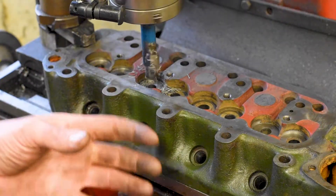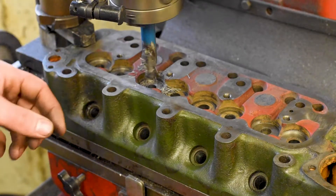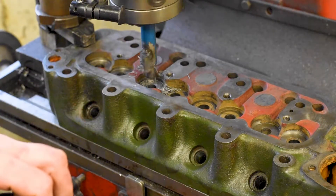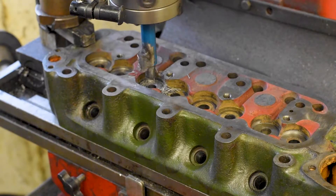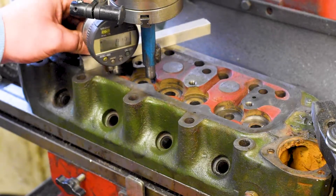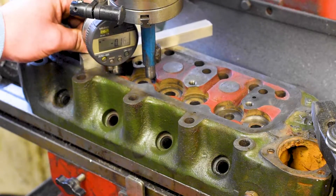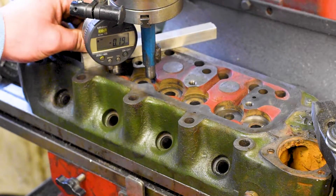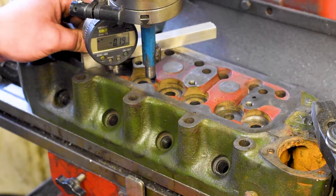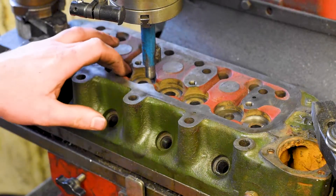Before we go any further, we'll pull back the cylinder head on the carriage and take a quick measurement to see whether we're right or wrong. When we have this set exactly where we want it, we can just work our way across the cylinder head. We're very happy with that — bringing the indicator in to check our measurement, we're sitting right there at 0.19, 0.2. So the indicator has settled in at 0.2, which is exactly what I wanted — 0.2 millimeters below the original factory seat height.